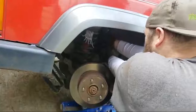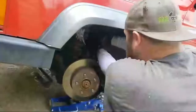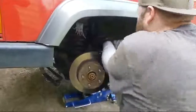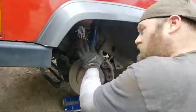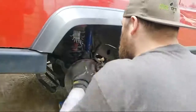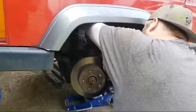We have more pressure on it now than the last one did because of how we're compressing it. Do not apply quick pressure to that coil when you drop it — drop it incredibly slow. Any jar of movement and the zip ties start failing one by one down the way.